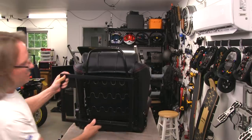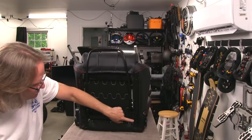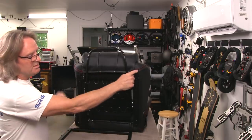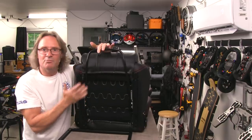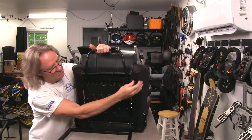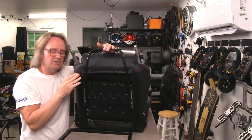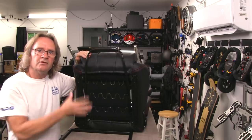We're going to take this bracket and mount it to the sliding rails, then take the whole thing over to the rig and bolt it up from the bottom. The seat has a slider on it, which is nice — once mounted we can adjust it back and forth. Underneath it actually looks pretty clean; I can see the hog rings clamping down all the vinyl, and even underneath they've done a real good job. They've got a hole here and holes down here for the mounting, and the sliding rails can be adjusted individually.